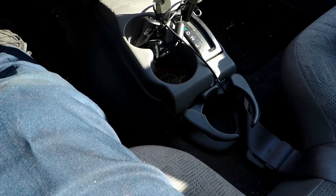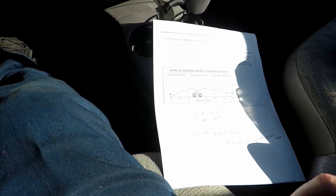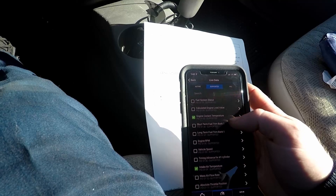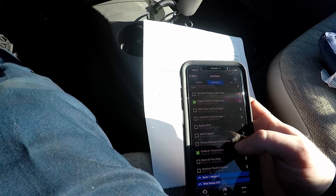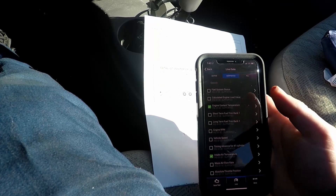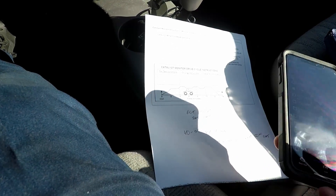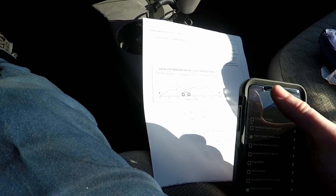As far as the enabling criteria, this one's kind of simple but I'll show it to you anyway. This one just wants it to basically idle until the engine's warmed up. So we go over into live and you can access whichever parameters you want. Usually the ones I look at are coolant temp, intake air temp, and then I usually have the oxygen sensors up too just to see what they're doing — fuel trims, all that good stuff. But in this one, all we really need is coolant temp and intake air temp. It wants to make sure it's below a certain temperature depending on how much you need to drive it. So go back to live and I've got those selected.